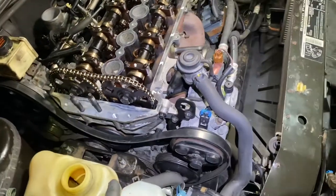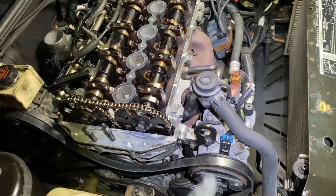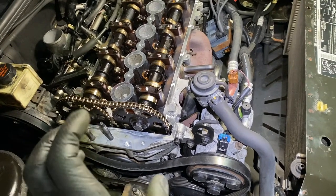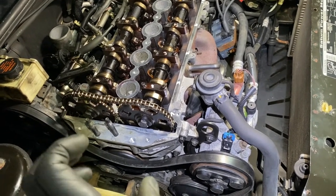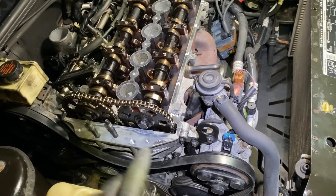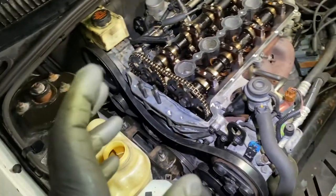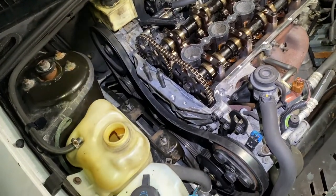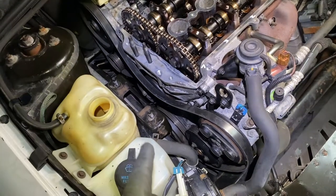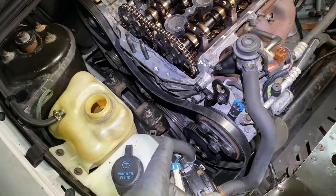Now, when you put the crank pulley on, right, clean up the bearing surface where the seal rides. I mean, the seal surface. Clean it up with emery cloth or something like that. Clean it, and then put a little oil on it before you slide it in, so it makes a good seal and it doesn't leak. Okay, and then you torque that bolt down, 160 pounds.